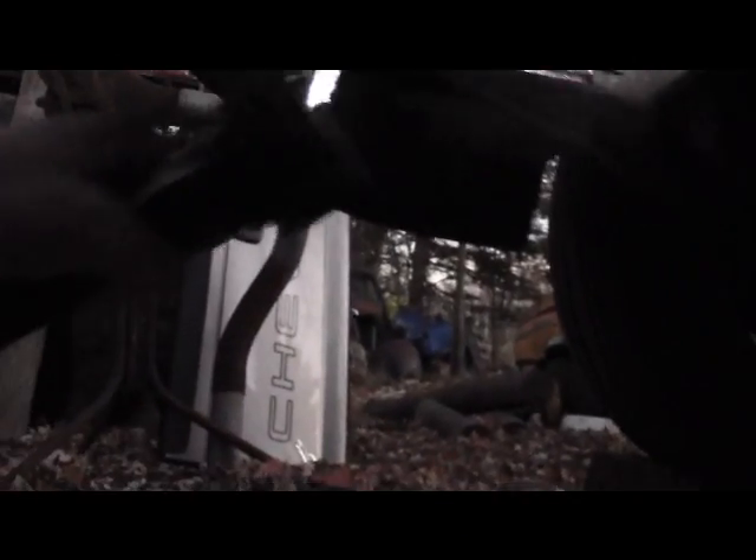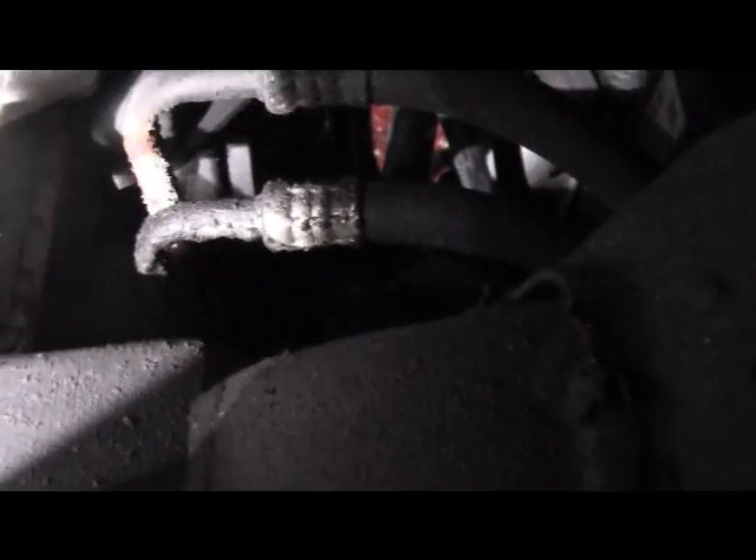You can see how much it was leaking just putting the car up on the ramps. It would be easier to probably take these push clips out here and give yourself some room. The area I'm talking about is up in here — you can see the lines coming down. It's pretty rotted right there at the right angle. They come down on this side of the cradle and into the side of the car. I'm going to cut the hose off right there, run my own steel lines, then tie-strap them.